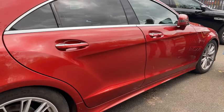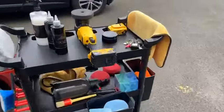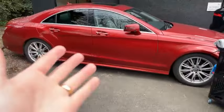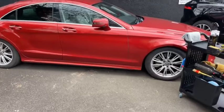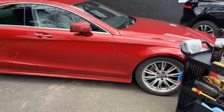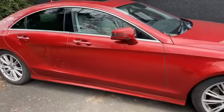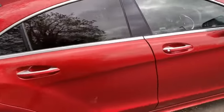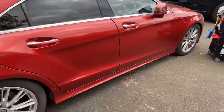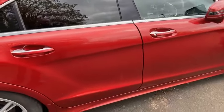That small amount of wax is probably still enough to do the rear quarter and front line. It shows you how little wax you actually use with a DA or by hand. From this jar you should get about 50 odd layers of wax on a standard-sized car — something like an Audi A4, Mercedes C-Class, or Golf GTI. In terms of curing, this is one of our luxury waxes and it has a high oil content.